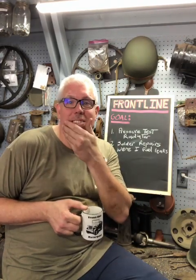So I got my motor started the other day. I want to thank Dustin, aka Bossman Wiley. Turns out that I wired the spark plug cables backwards. I was thinking that the distributor turned clockwise. It actually turns counterclockwise, and so my 2 and 3 wires were crossed, so it would sputter and it wouldn't start.